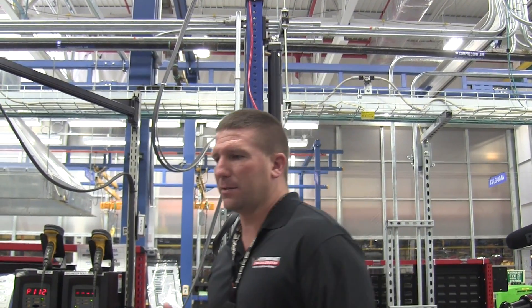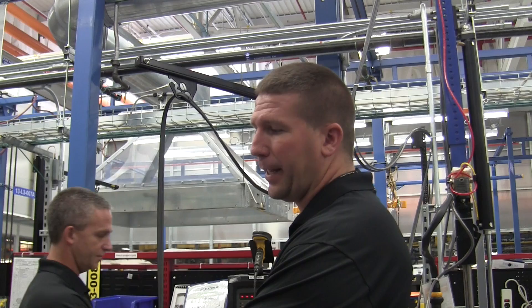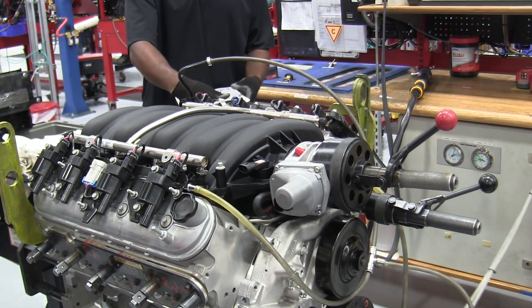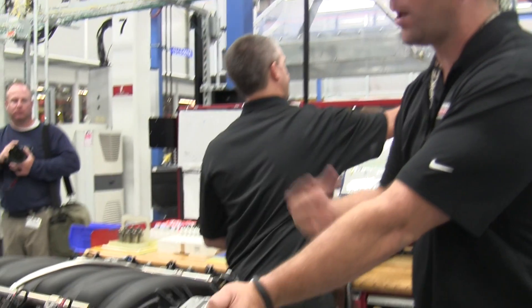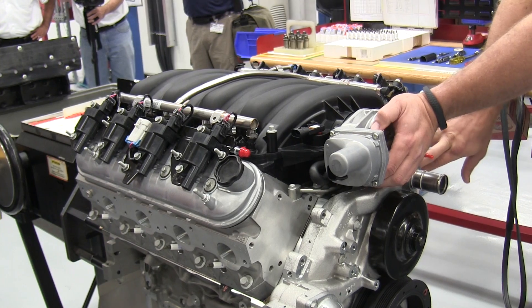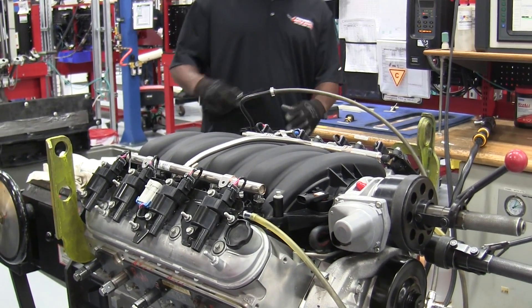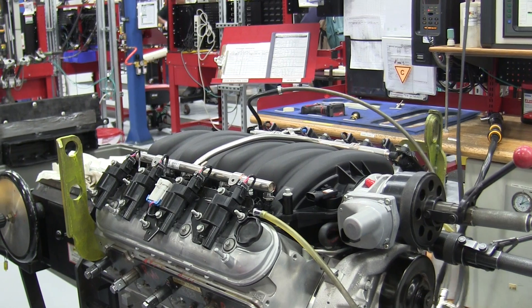For the leak test, all orifices known to leak are closed off. We check the crankcase, front and rear seals, oil pan, and intake manifold — pressurized to 2.25 psi — and measure how much that pressure drops to detect leaks. We also pressurize the cooling cavity, including the water pump, heads, water jacket, and block, to 20 psi. We watch the pressure decrease over time, measure the leak rate, and if there's a leaker we find it with soapy water and correct it.